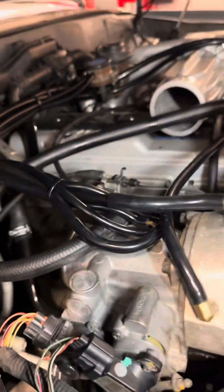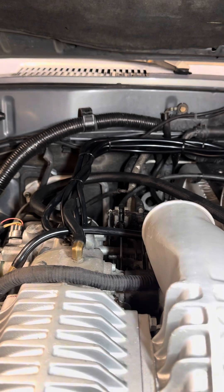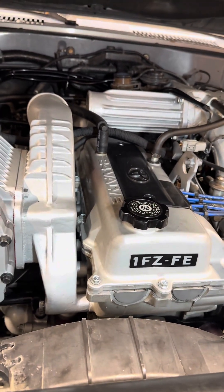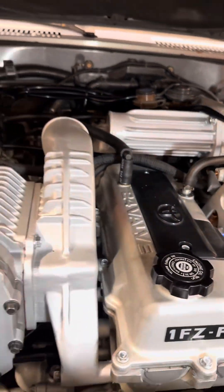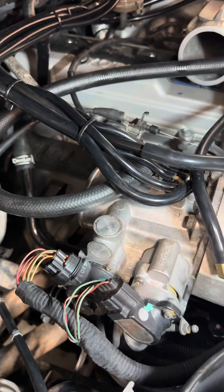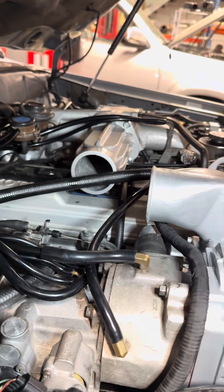The rigid line that runs to the brake booster already runs down this way, so I just ran it along the same path and zip-tied it. It's at least grouped in one spot, which should make any service a lot easier than routing everything under the intake runner. For the wiring I did it piece by piece and ran sheathing over it. Go slow and make sure your heat shrink is on before you crimp the ends.